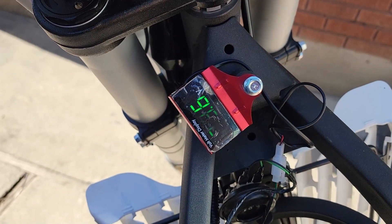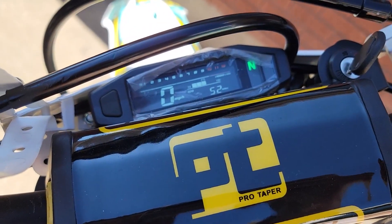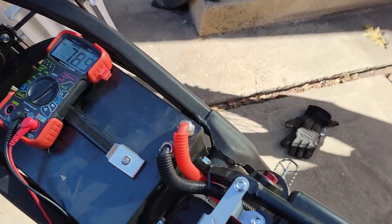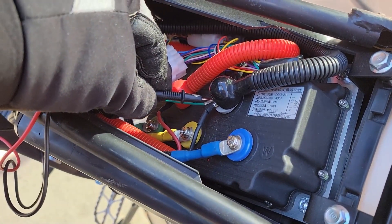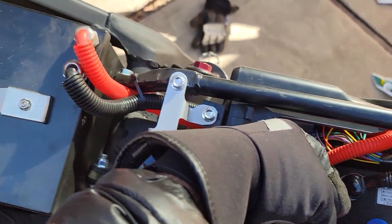However, right back here under the seat, these ones are live — we can see the voltage on my voltmeter plus the digital display, and the key is on. So you can't go deeper than your seat in a river — at least not past here — or you're not going to have a good day.